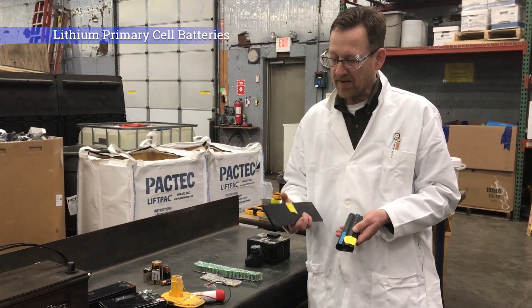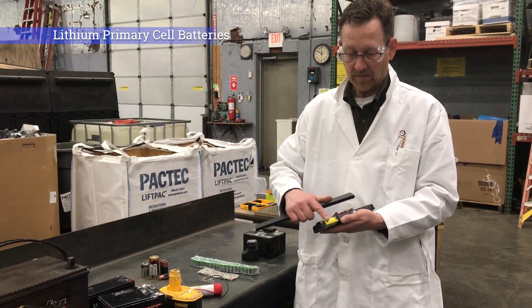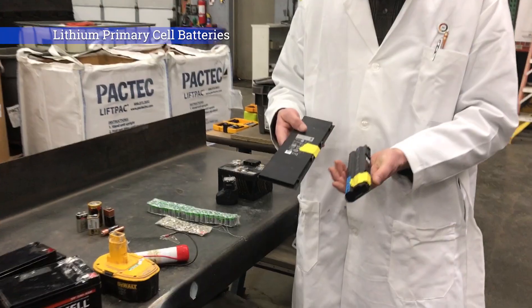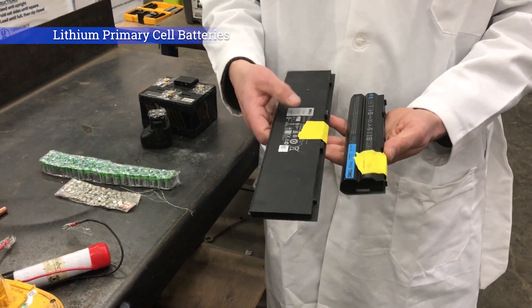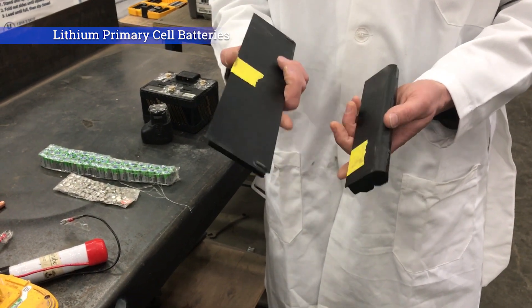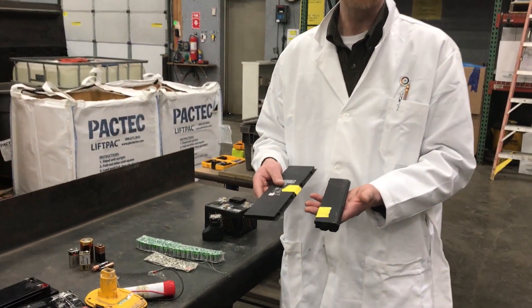Here are some examples of laptop batteries — the kind that would just fit in the back of a laptop and snap in place. They often have a small connector toward the laptop, kind of a copper color. These are the same type of chemistry even though they're in a flat, very thin design compared to those round or button cells — probably the highest energy density of all batteries. DOT is very concerned that these are completely taped no matter what their voltage is, to prevent fires.